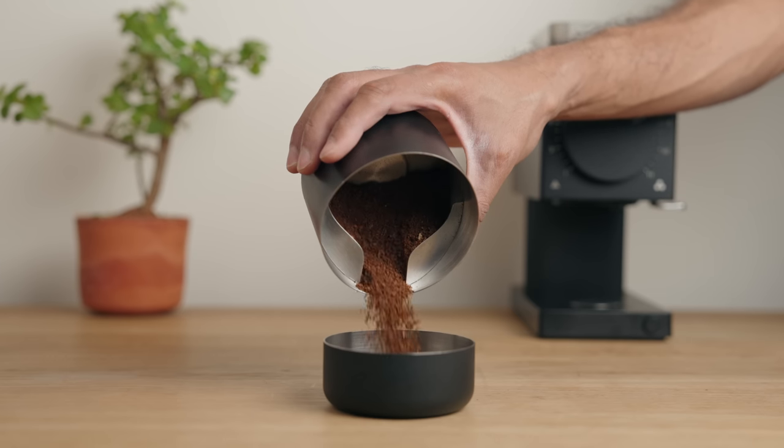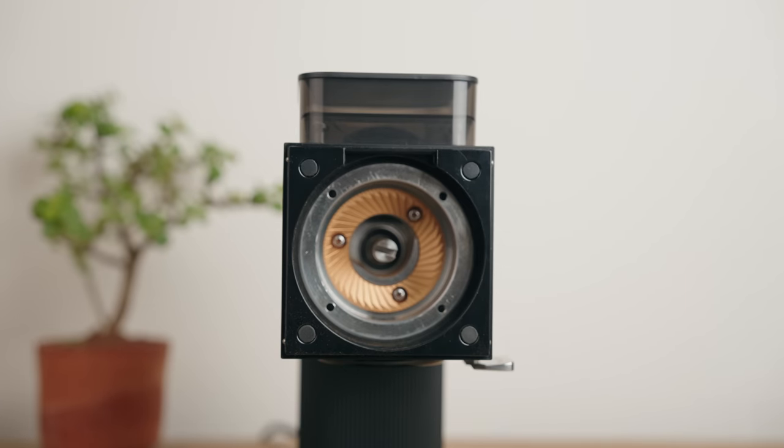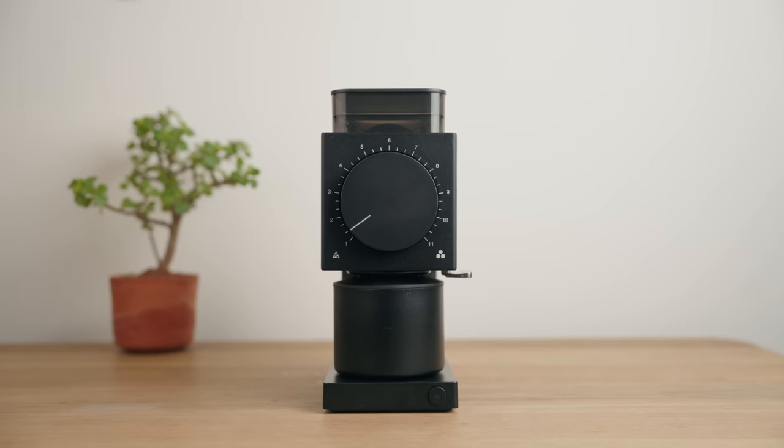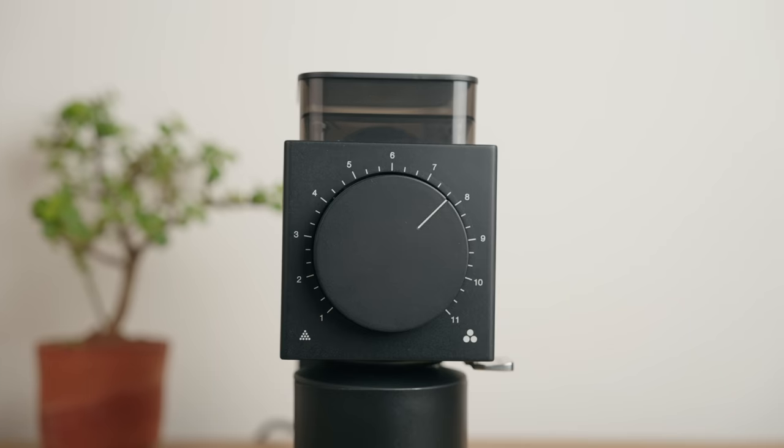This grinder is very similar to its predecessor. It's got the same 140-watt motor that is PID-controlled to help keep the RPM consistent during the grinding process, which really helps with grind consistency. It houses 64mm vertically mounted burrs, which means you can swap them out for the several third-party options that are available — though Fellow only officially support the SSP multipurpose ones, and anything else you drop in is at your own risk. You have a large step dial that gives you 31 settings with each click moving the burrs 25 microns. These are fairly large steps, but it's a filter-only grinder, so this level of granularity is sufficient. If you find yourself consistently wanting to be in between clicks, there's a super easy mod that makes it stepless — just open it up, remove this small piece, and reassemble. You may need to add a few layers of plumber's tape to the threading to reduce lash and prevent the dial from slipping.